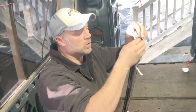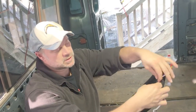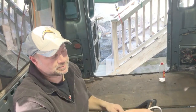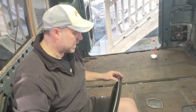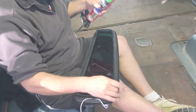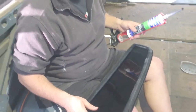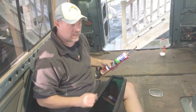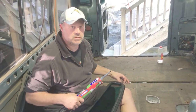This cord is just something from Bunnings — I think it's a 4mm cord, just like a clothesline string cord, not like a wire or anything. At the bottom it just overlaps, and that's where we're going to start — placing it in at the bottom, then pushing down and working our way around. First I'm going to put some black RTV windscreen sealant around the outside edge, the one that's going to push up against the outside body of the bus, just as a bit extra. Because these windows have been a bit of a problem with rust and water getting in, we want to make sure we don't have to do this again.